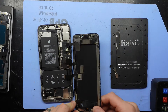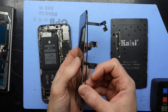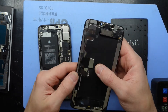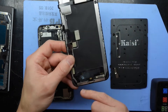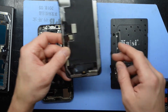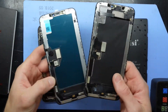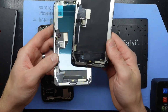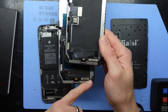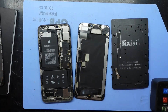While I was opening this up I was suspicious it had been replaced before. The biggest giveaway was the frame coming away from the glass, and once I got in there it did almost look like there were signs of water damage around the bottom. It also looks like it had nearly the exact same LCD display put on it previously — you can see the same module down the bottom. And once I connected it up to my reader, all the serial numbers came out completely blank.